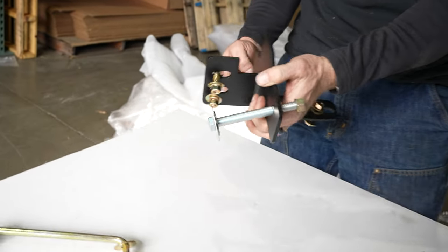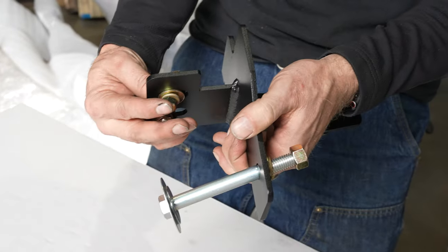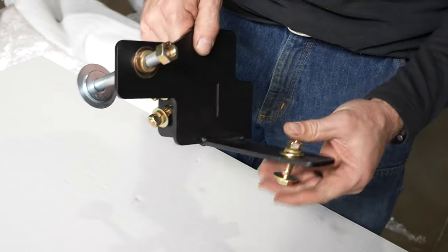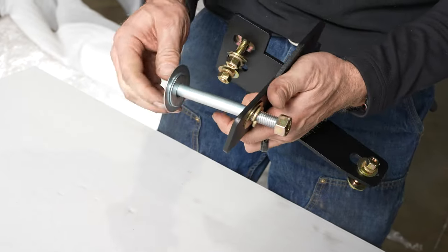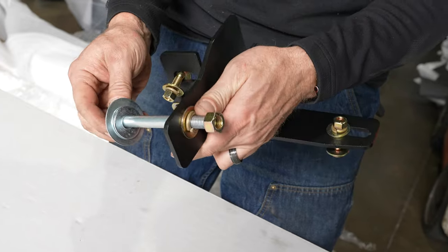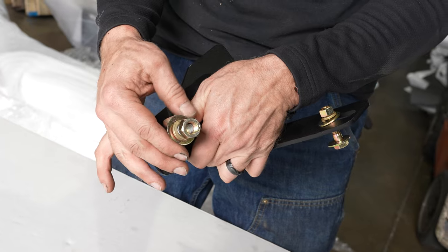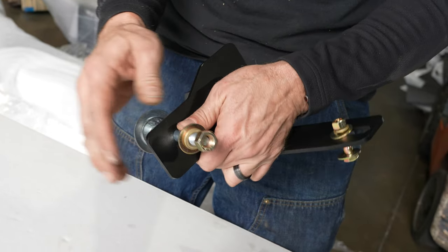This will be on the left side or driver's side. Your inch-and-a-half, 3-inch hardware there and there. This will be a 4-and-a-half-inch half-inch bolt, large washer, washer through the frame, another washer, lock nut, and nut.